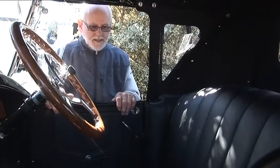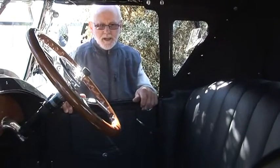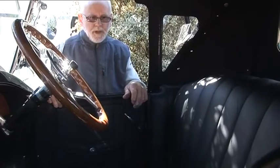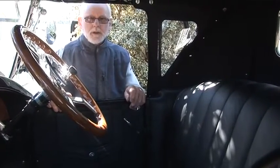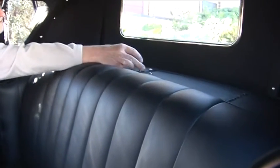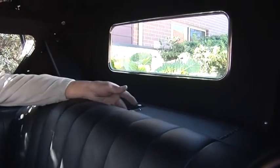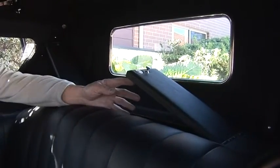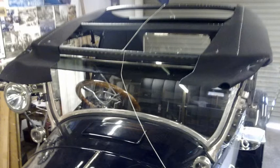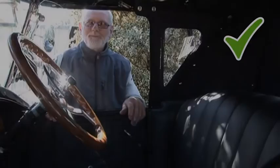Then I tackled first of all the actual seat manufacture. That has to be made on a ply base. You have to attach metal coils for the springs inside the seat, then you cover it with foam, calico, foam, and hog rings and staples, and madly make seats. And then I had to do the roof, which was a lot of trial and error, but eventually got there. I think it came out quite well.